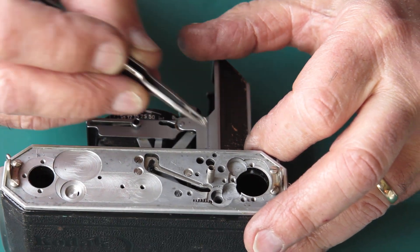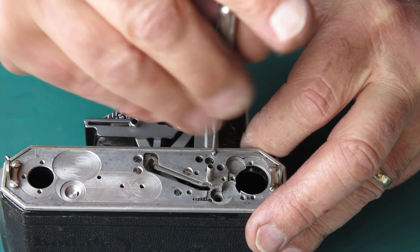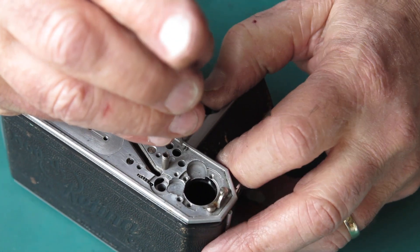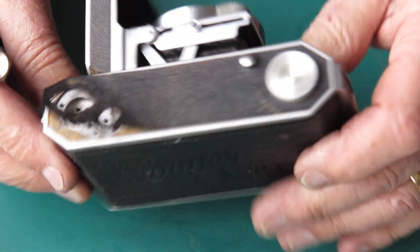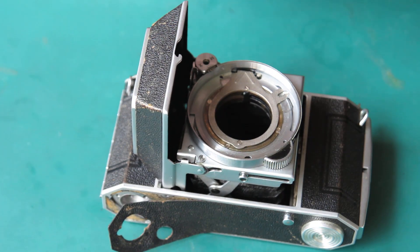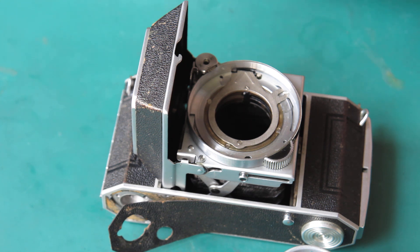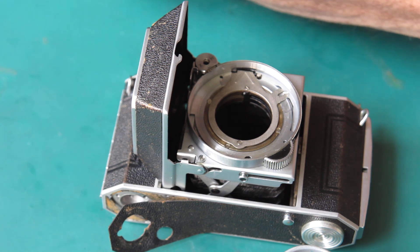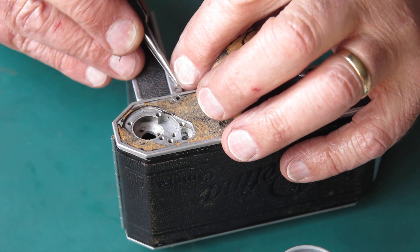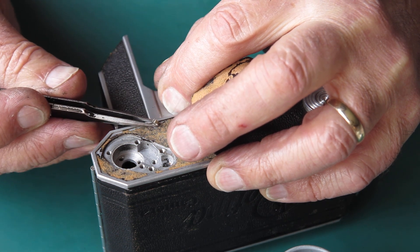The original paper washer looks the part better, so I'll put that one there and its mate I'll put down at the bottom where it's less seen. I'll get the door clipped into place — start by getting the bottom pin in place, then lifting the door up, swinging it over, and getting the top one in place. Now we've got two hinge pin screws — get the top one in position. Checking the movement of the door — there is rattle here, so it needs a spacer washer to take that rattle out.